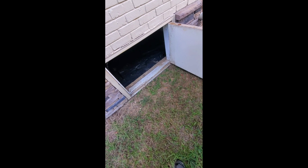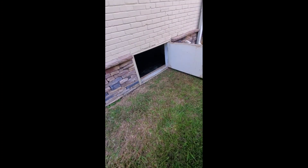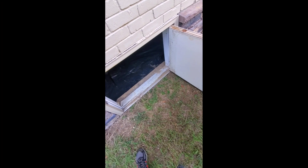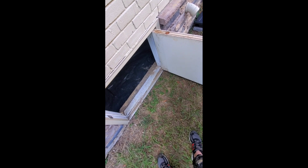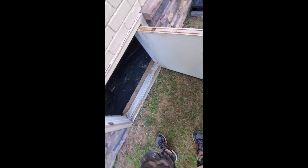Look, it's my top secret squirrel door — I go in the squirrel door back there. I got this squirrel cage off and I'm trying to get that fan off the spindle. I tried using my lineman's pliers — that didn't work too well. Now I have a hammer and I'll hammer it to see if I can mushroom the tip so I can get it through the fan slot.